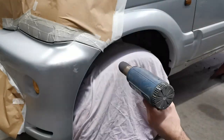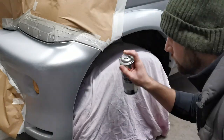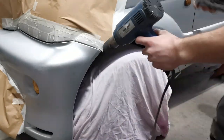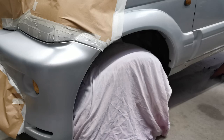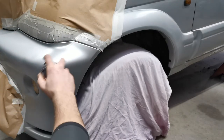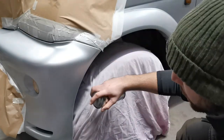I am using the technique of losing the paint, both down the bumper and across its width, in order to graduate and seamlessly blend the new paint into the old. Using this method, I will lay down 2-3 coats until they have a fully covering, uniform colour. Even though I'm working straight from a rattle can here, with the correct technique and enough practice, this can produce a seamless blend between old and new paint.